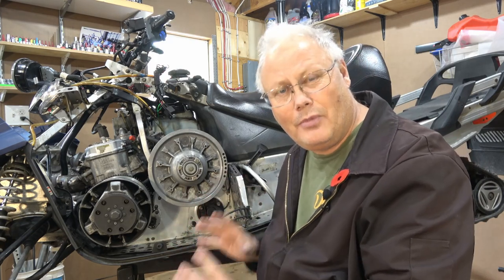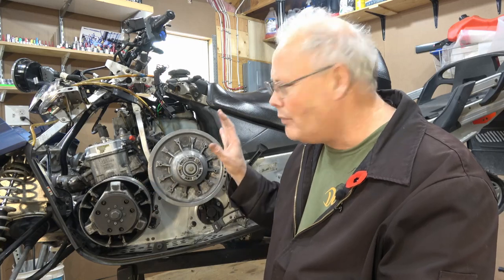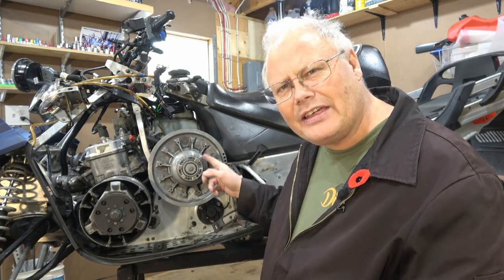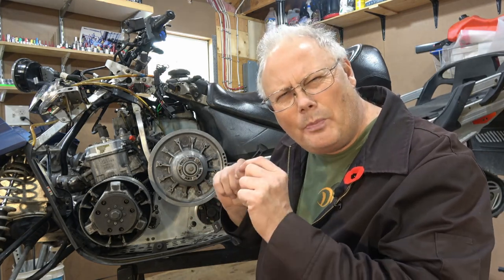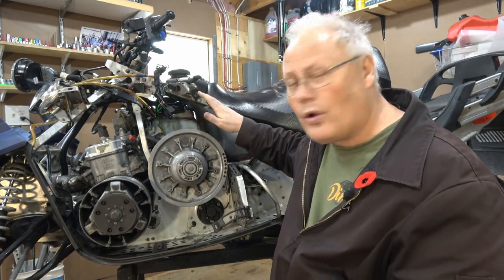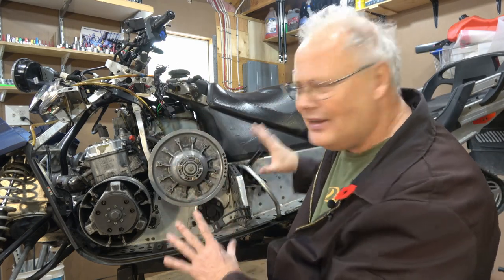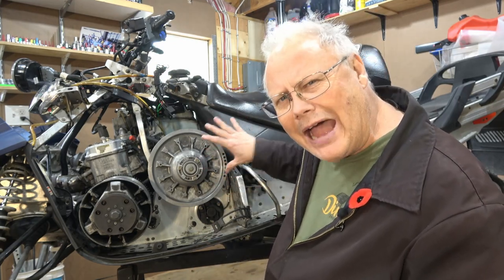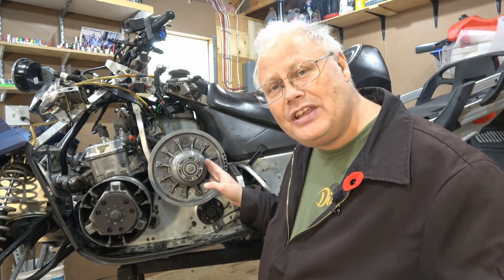Because this machine is brand new to my friend Mark, I want to take these clutches apart, polish them, and inspect them for any kind of catastrophic damage that might be hiding inside in the castings. I also want to check the buttons on these — they have little small Teflon buttons in there that slide on metal surfaces to make these things shift well. Today we're going to take a look at the secondary clutch, or what's known as the driven clutch. Everything's pretty clean here because I've already had this clutch off and inspected it. The machine was so greasy I found it difficult to operate the camera, so now that it's all clean, I'm going to walk you through how to get this thing off and how to service it.